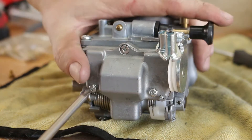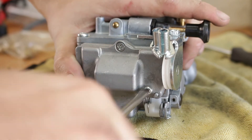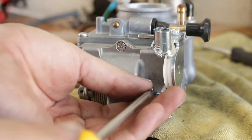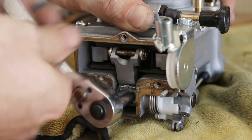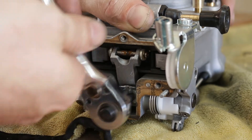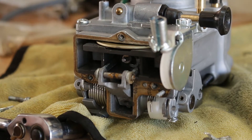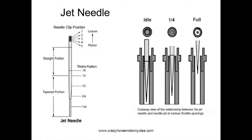The carb setup is now almost there, we just need to change one more circuit. The jet needle has the most profound effect on jetting because it's the circuit that you most often use in day-to-day riding. The two main ways to adjust the needle setting are by moving the height up or down, or by swapping the needle for one that has a thicker or thinner taper. A needle that's either too lean in clip position or taper diameter will make the engine response flat and dull, and if you have an issue with bogging or cutting out during your E85 conversion, it's likely caused by the jet needle.